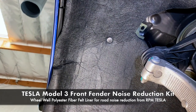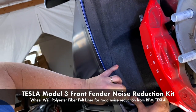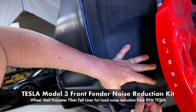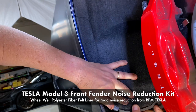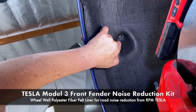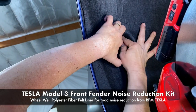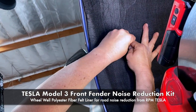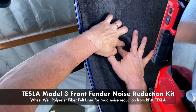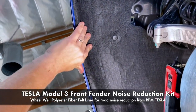So we have one in. Okay, before we put in the recessed cone, it's a good idea to position this in here, and that'll help boost up the whole thing. So we're just pre-lining up these lower grommets as well. So we've got these two here, and now this one's lining up better. So you see, I need to just tug it a little bit. Once you tug it towards the fender, put it in, put the Phillips screw head plastic in, and shove it in. And it's locked. Great.